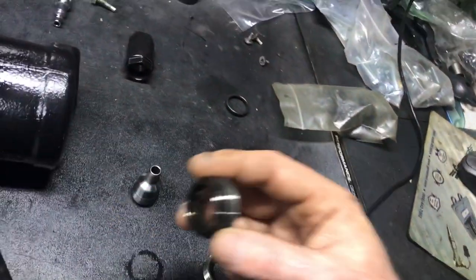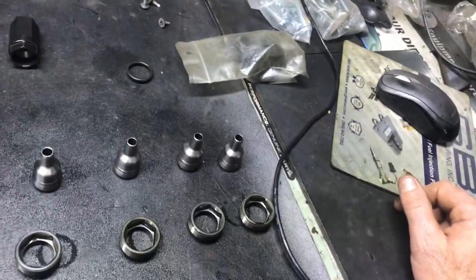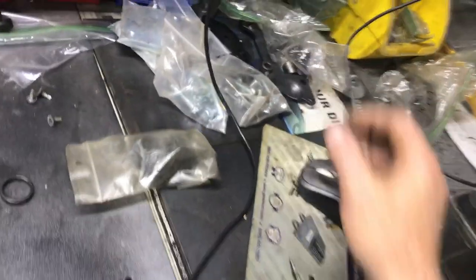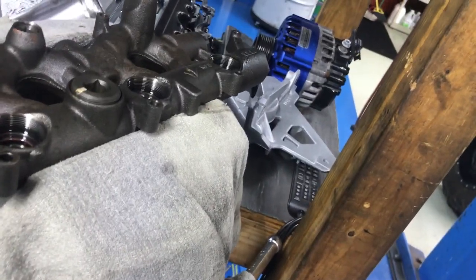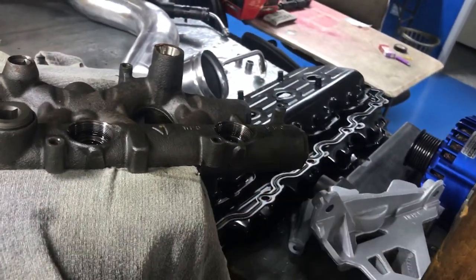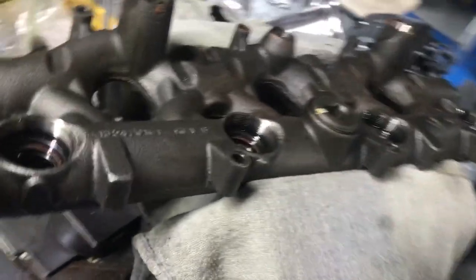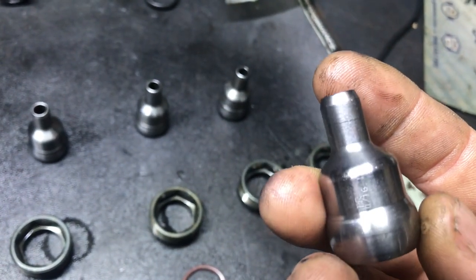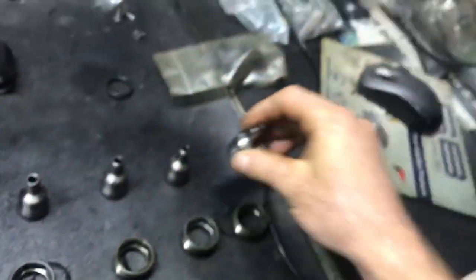With how I popped that oil rail on there, I took it back off, put it on, and it just didn't feel right — not like I'm used to. So I took the thing back off. I said I need to go back in the boneyard and find a good set of nipple cups, take them out of an oil rail. I'm not going with that. With a full set of injectors, this one over here was moving like crazy — it was not even an option. I should have recorded it but it moved so bad. I said no, we're doing nipple cup o-rings. When I took them off I saw the engraving: GBR 10 to 16.